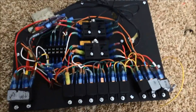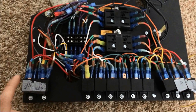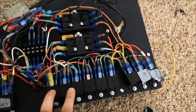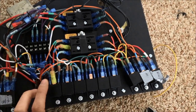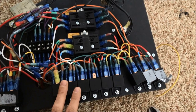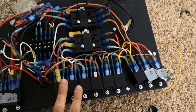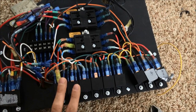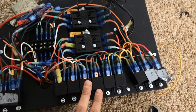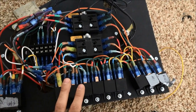Here's the back side to give you an idea of the layout. I'm going to put this in the car pretty soon. These are the relays for everything that needed relays — a defroster relay, fan relay, accessory relay, horn relay, and a combination of headlight relays and parking light relays. I also have a setup so that when you turn on the parking lights, that allows you to turn on the fog lights. When the fog lights are on, you're not allowed to have the high beams on at the same time in Pennsylvania, so another relay kicks off the fog lights when the headlights switch on.